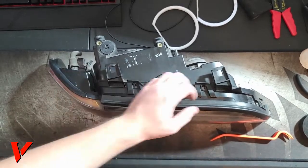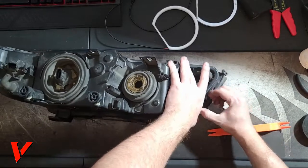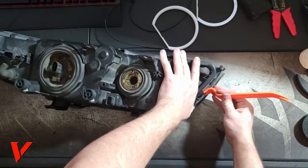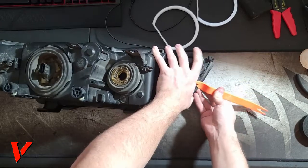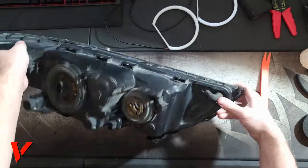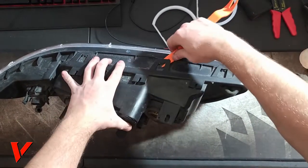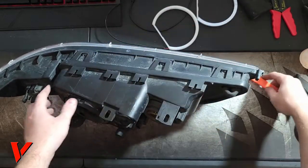So this is lifted right here. Gonna release. Same thing right here on this edge, and this is where the fingers can be little. It can be tough on fingers. This is when it's convenient to use a pry tool. Here we go. I got this lifted. Now the three on the bottom will come out fairly easy. There's one, there's two, and there's three right here.